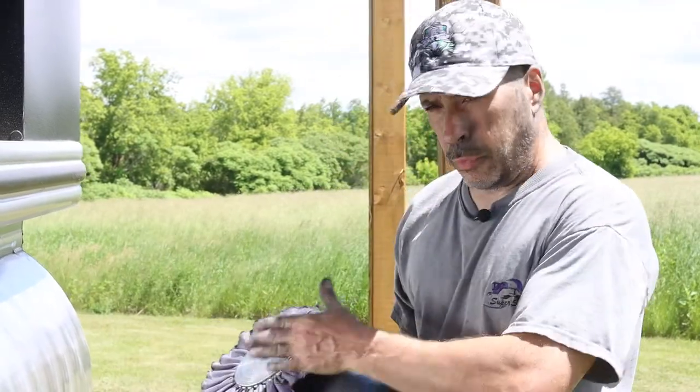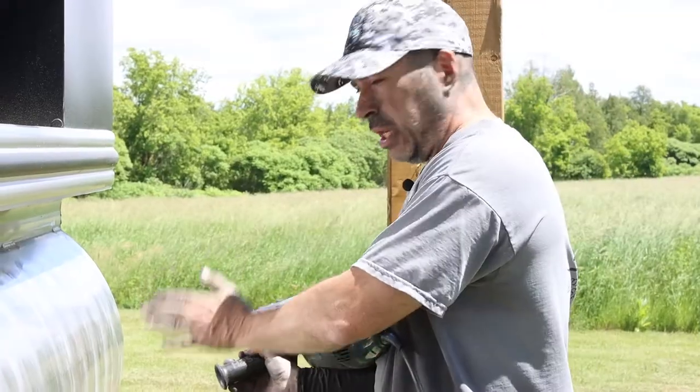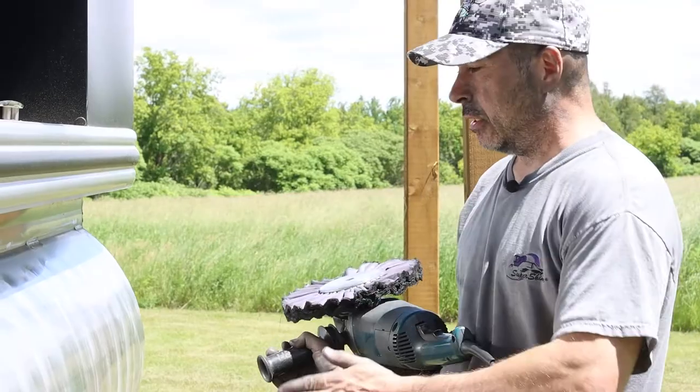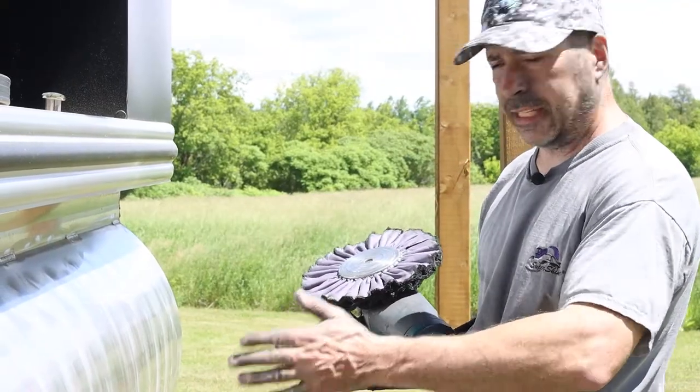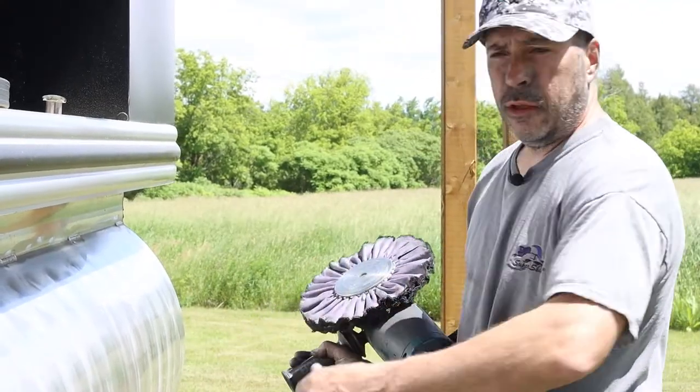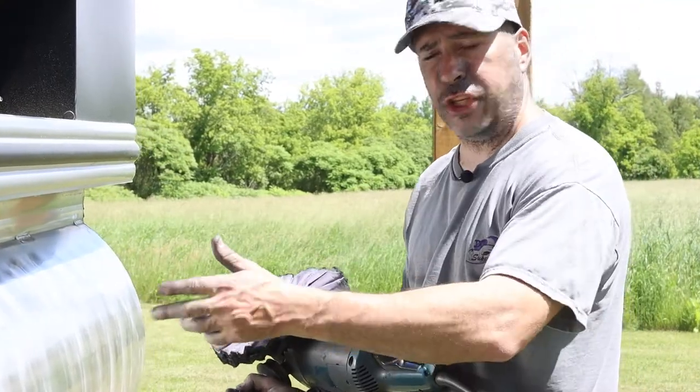Okay, so I'm gonna be using my 6000 today. We're gonna work in sections. So basically, I like to work from weld to weld, but I'm gonna cut all that into several sections. I probably work about 14 to 16, 18 inches wide. So this will probably be four sections, and then I'll blend it all in after and then do my finishing.